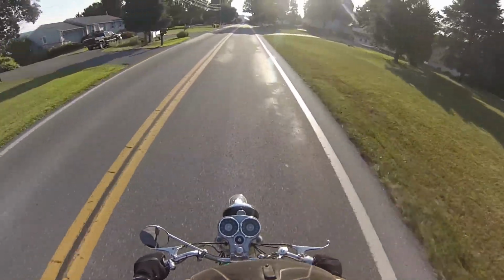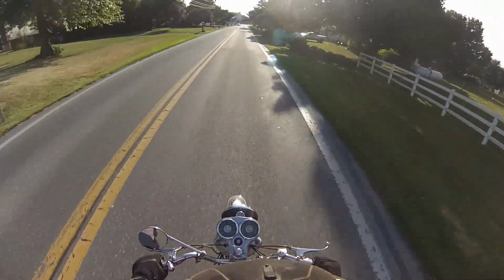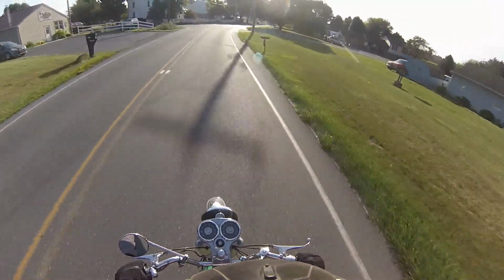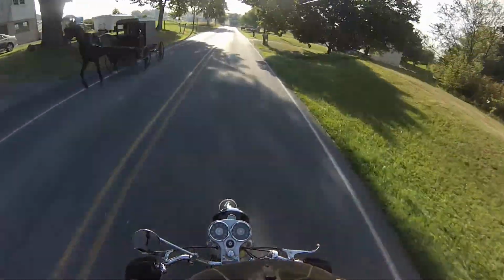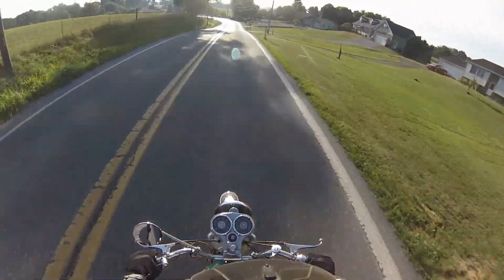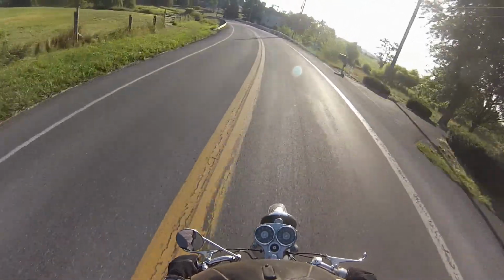Come up to a first or a stop sign, you push that, takes you right down to neutral if you're in any of the top 3 gears. I still have to kind of look most of the time because I have not trained myself yet to feel where that lever is on my heel. Kind of a mess there. At the neutral finder, you got the kick start lever. It's kind of conspiring to make your life difficult, but it is possible to do it after a while, but just learning where it is.